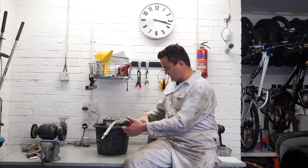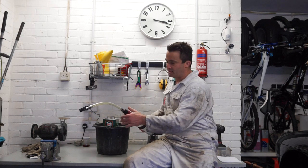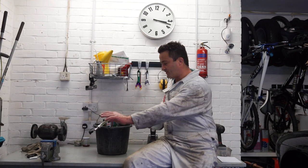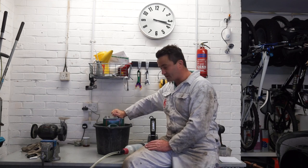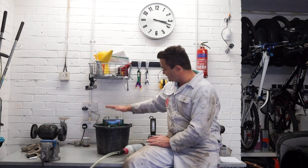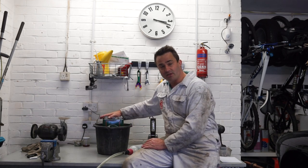For refilling the oil, a very useful tool is this oil pump. You can fill it up with the correct amount of oil and pump it straight into the gearbox. I think trying the job without the tool is possible, but it does make it an awful lot harder. I've also got a bucket of hot water here with my gearbox oil in it. The one I'll be using is the Castrol Classic 20/50, exactly the same as the engine oil in most cases, and this comes from Opie Oils. I'll put a link in the description below for both the pump tool and the oil.